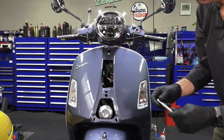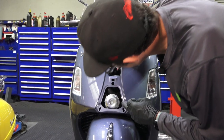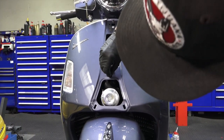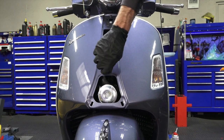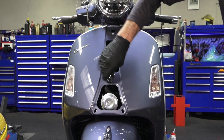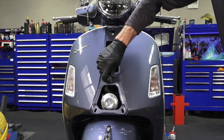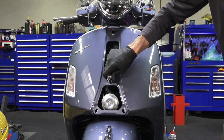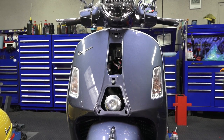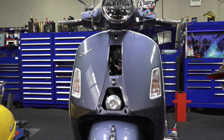The first step: take this extra-long spacer and sight down this hole right above this horn right here, and go ahead and start that fastener up. I'm using a little ratchet because you do not want to over-tighten these. You can't torque these all the way — they typically will break. They're just a little bit softer steel compared to a regular bolt.